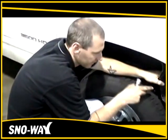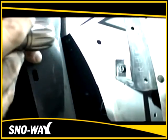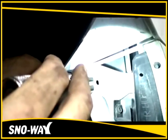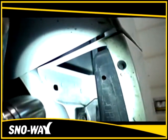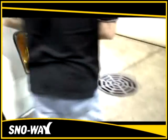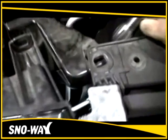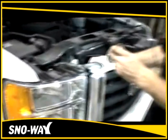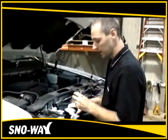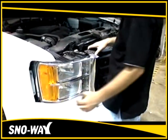Once you've removed the bolt and the two clips, open this up. Inside, there's another bolt — remove that. Once the headlight is loose, there is one clip on the back side right in here that needs to be slid sideways — it can't just be snapped out or you'll break it off. Because you've removed the clips and bolts on the grille, you can bend it forward wide enough to slide the headlight sideways, and then it will pop right out.